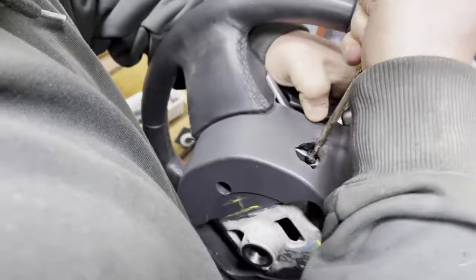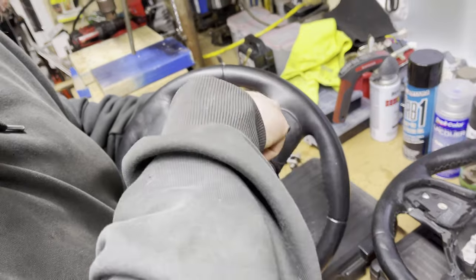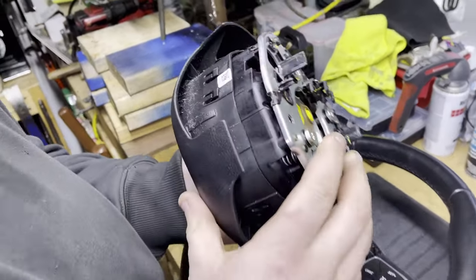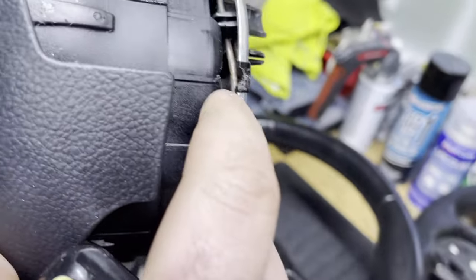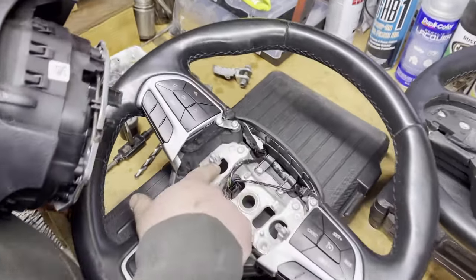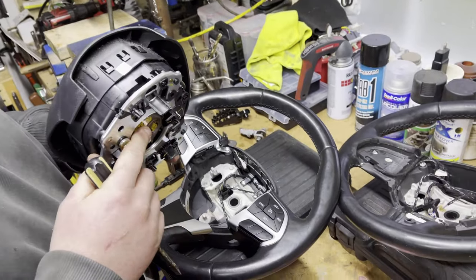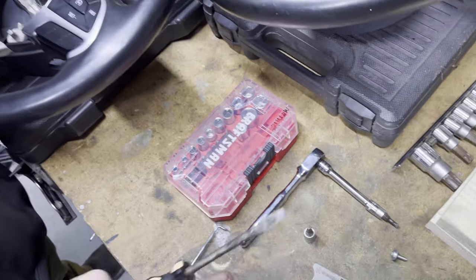It's difficult to do one-handed — definitely a challenge. We'll pull it off and explain it here. Popping it off is so easy it's actually hard to do when it's not mounted because you don't have that force to hold it in place. You see the hole right there — you push this pin in just like that. That pin clips onto little ears that stick off on either side; you go in from the bottom, push in right here, and it pushes that across. It's so easy. A lot of videos make you think you have to go way up in — no, it's right as you go into the hole.